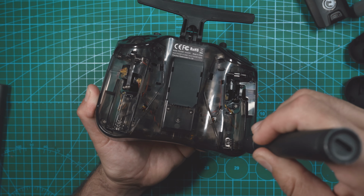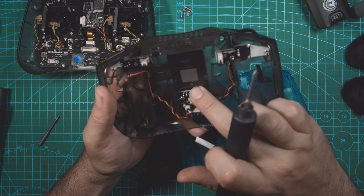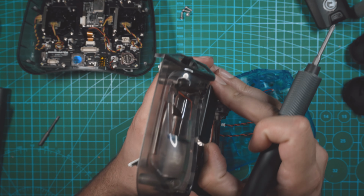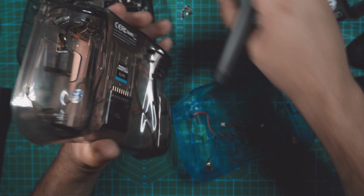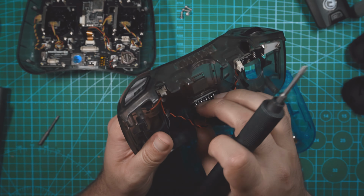And then when you take apart the controller, there's 1 ribbon cable right there. And I'm just gonna pull it out of the main board. So that's that right there. So we are going to have to remove these things and transfer them over to the other cover. Now I'm gonna switch this to a Phillips. We'll take this board off right here. And actually I'm gonna remove this because I don't want it to be locking anything in place. But this board is held in with 3 Phillips head screws.